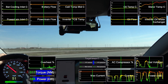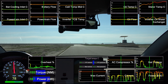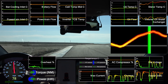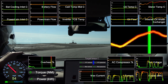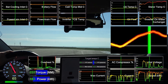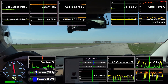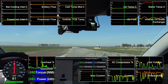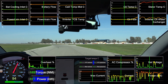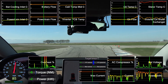And this is kind of the tragedy of the Tesla. Even after a cool-down lap, the car isn't performing much better. I want to point out the slope of this stator temp graph again — this pattern looks really artificial, as if the stator is allowed to heat at a certain rate for a short time, and then it switches over to a lower long-term rate. This time we're starting the high-speed section at 115 degrees Celsius, which is bad, and we're really suffering for it. The car is happy to play around 100 miles an hour for now, but that'll change.